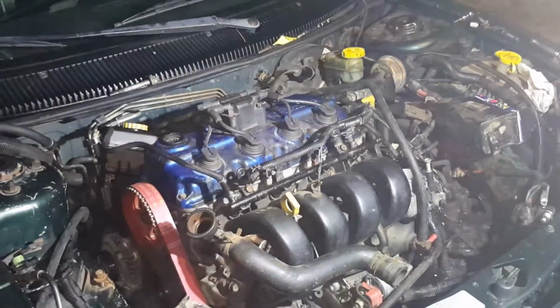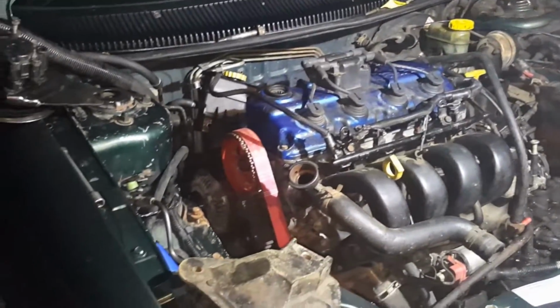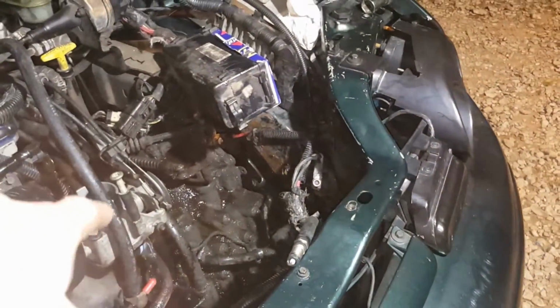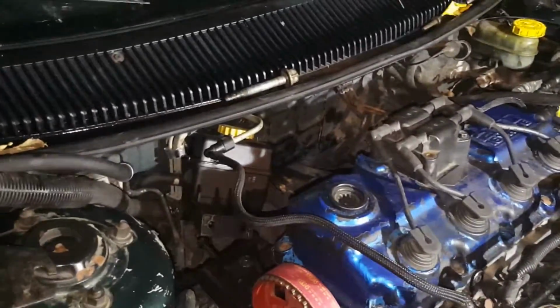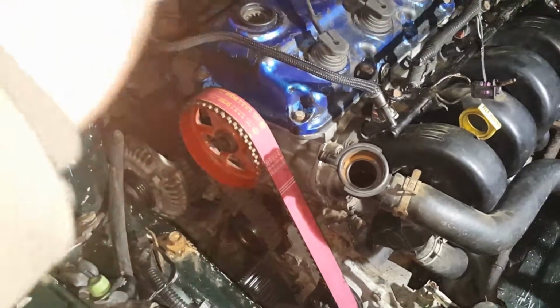And a nice startup of it actually running without an EGR leak or an exhaust leak. What you heard was an EGR leaking and the exhaust leaking. And I think the EGR that I made a long time ago on the intake might be leaking too, because that's why I had a little less throttle response. I mean, it had more throttle response, but delayed.